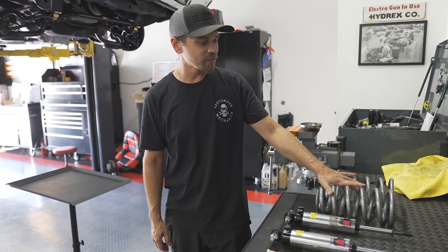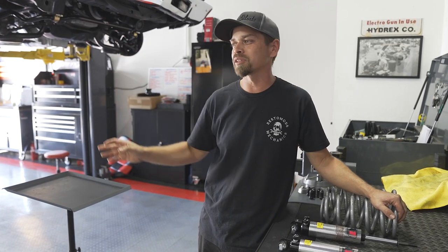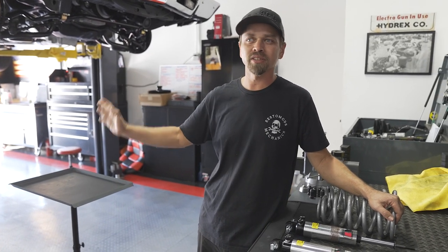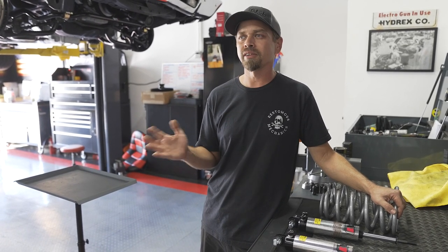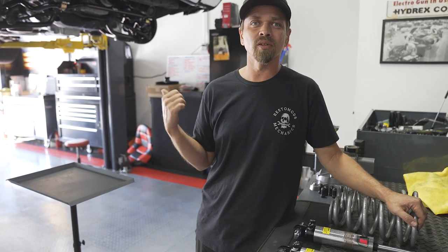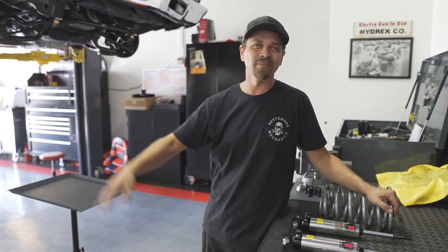But when we needed to change the spring rate a little, and that's kind of been the theme through the whole car. When you want to upgrade something or match the power level of this new engine, we just went full bore. So everything that we upgraded, the brakes, these coilovers, a bunch of chassis stiffening stuff, was just to be able to manage that power more safely in this old car. I think the old engine dynoed like 480 horsepower, which is no slouch. That's nothing to scoff at, but this thing's going to be well north of 800. We're hoping for 9-something horsepower. So what goes along with that is making everything behind it better, making it all survive.